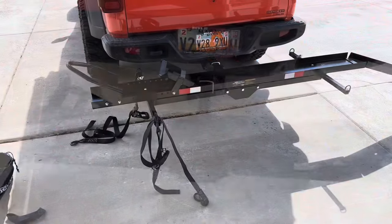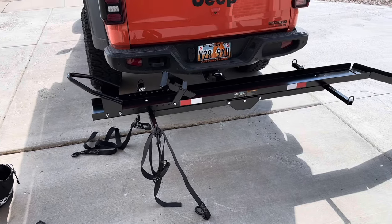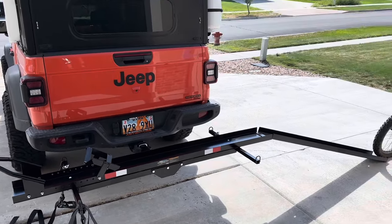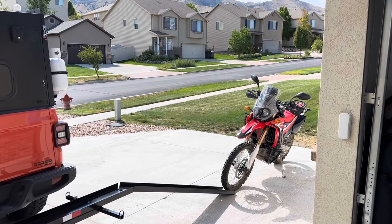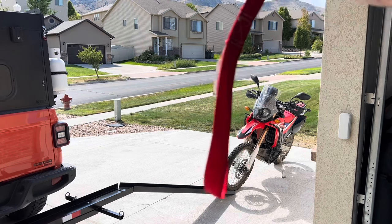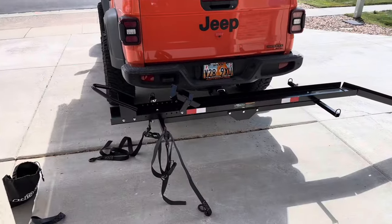Before you try to load your bike, there are some preparations. I've put the front straps in place that I'm going to use to hold the bike up, because once you get it up there you can't really run and grab the straps. Line your bike up straight with the ramp. We're going to start with my lighter bike first to make sure I can handle that before moving to the Norden 901. I'm going to put soft straps on the bike so I have an easy place to connect up to with the straps on the rear rack.